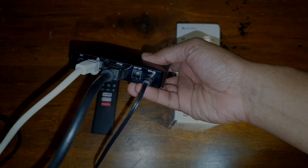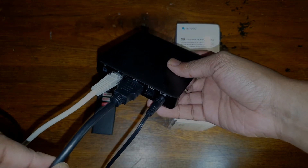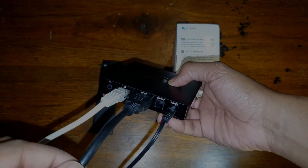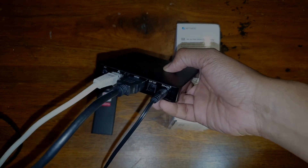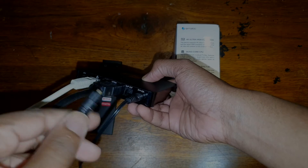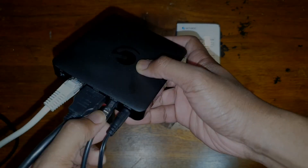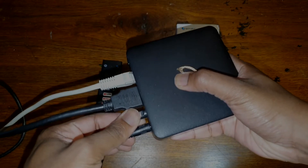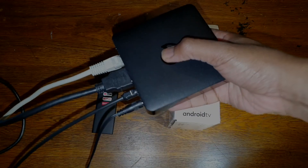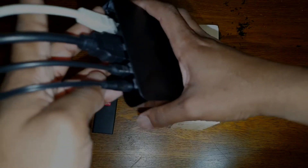A lot of you might be happy with the HDMI cable alone — you connect it to your TV, and if you have HDMI ARC you can connect that to your soundbar or sound system as well. But I decided to go old school because this supports optical audio. I've got an optical cable — you line it up nicely, it's a bit tricky to insert, but once you hear that clicking sound it's connected. Connect the other end to your receiver or sound system, and automatically the sound will pass through.